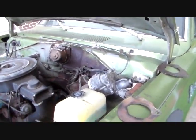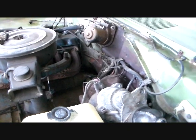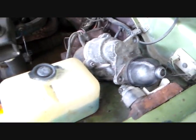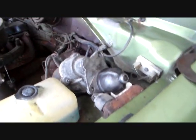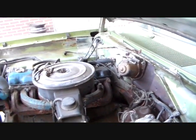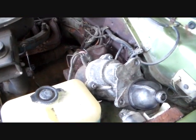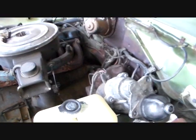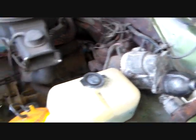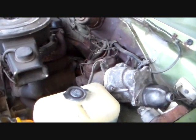Now here's the difference. Some of the older cars, and mainly it was just trucks and vans, but there were like a couple cars, like Hemi cars, I think, used a direct drive starter. It does not look like this. It's a smaller starter. Looks a lot like a Ford starter. And that's mainly like if you guys up in Canada that have the Fargo trucks, a lot of them use a direct drive starter. A lot of industrial slant 6s use a direct drive starter. So if you have a direct drive starter on your engine, you cannot just put a gear reduction starter like this one on it and have it work. Even if it bolts up, it will not engage the flywheel because the flywheel is a different diameter. So it's not going to work. You have to match the flywheel to the starter, unfortunately. That's the only gotcha. So you're kind of stuck with it.